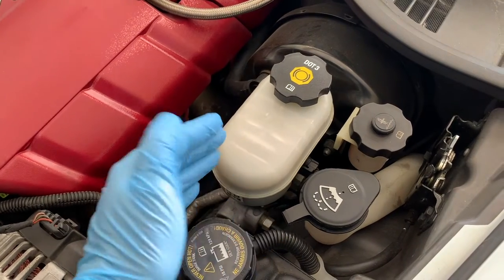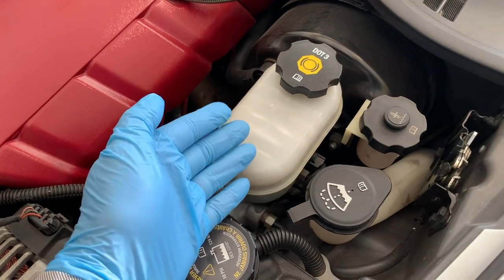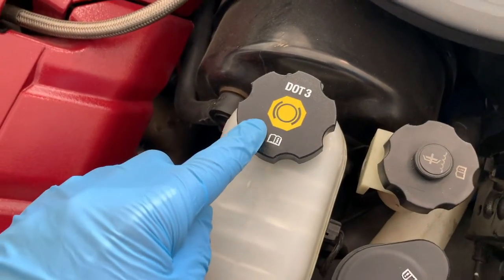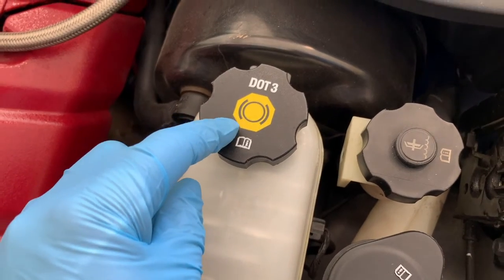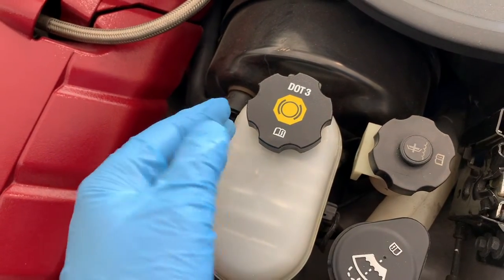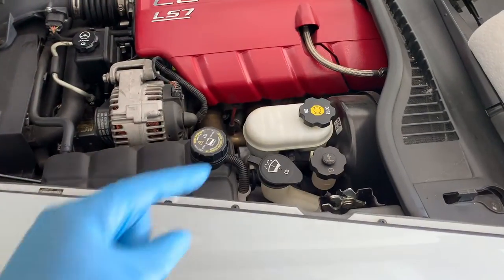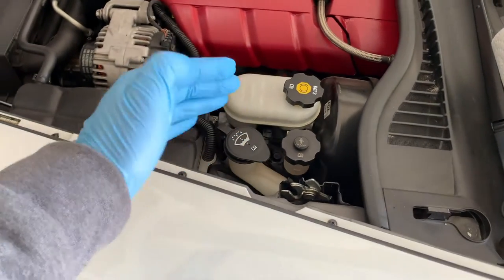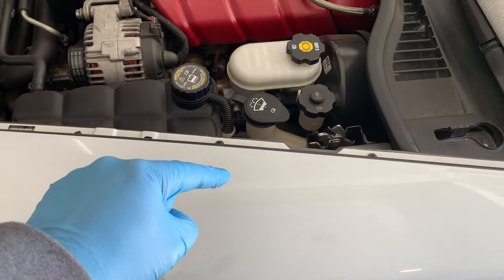Brake fluid's big issue is whether to use glycol or silicone-based brake fluid. They don't play well together, so knowing which one you use is critical for the performance of your brakes. Brake fluid is referred to by its DOT number and can be found in multiple varieties, though most passenger vehicles take either DOT 3 or DOT 4. The DOT refers to the Department of Transportation, which issues detailed standards for all motor vehicles' brake fluids. DOT 5 uses silicone instead of glycol, which is now the standard for most military vehicles. For race cars and show cars, you'll want to go with this type because unlike glycol, it won't eat through the paint of your car.